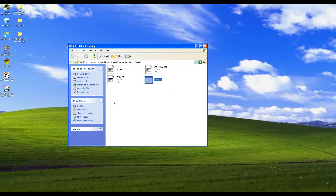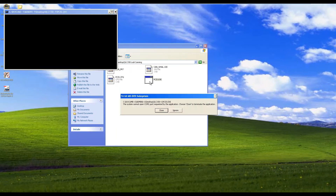I'll demo PCIS on a 32-bit Windows XP virtual machine. If you're curious about virtual machines, I've got a ton of videos on that. We've actually got two virtual machines open here - I'll be jumping over to a Windows 7 version in just a second. When I double-click on PCIS, it's going to look to open COM 1. With that adapter attached - probably via a USB-to-serial converter on a modern laptop - you'd want to make sure it's set up as COM 1 in Device Manager.